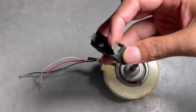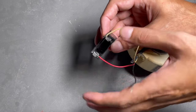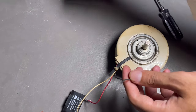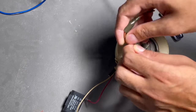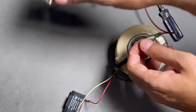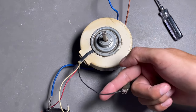The rotation depends on the fan motor rotation. Red and white wires connect to the capacitor as shown in the diagram — exchanging red or white is no problem. The main brown wire connects to the fan motor black wire, and the blue neutral wire connects to the red wire capacitor point side.